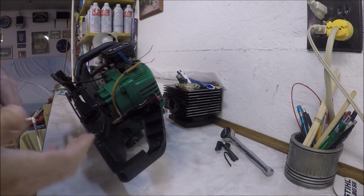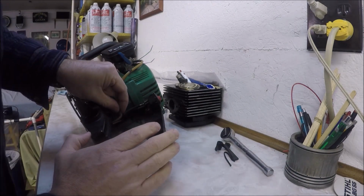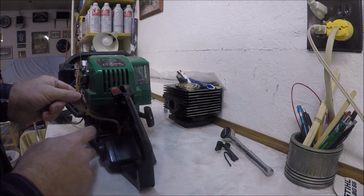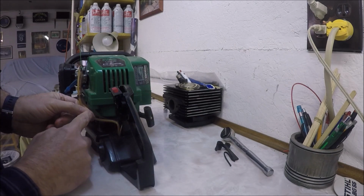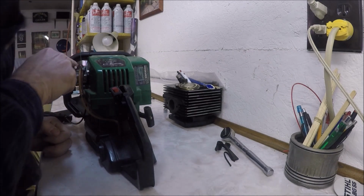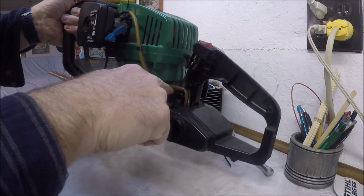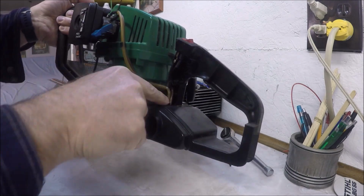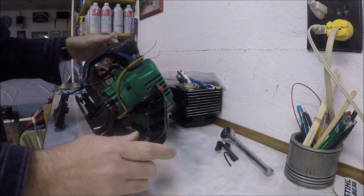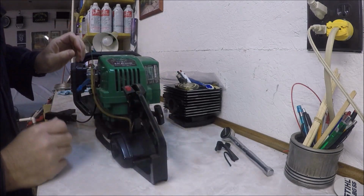So now what we've got to do is we've got to get the 2 fuel lines out. So the fatter tube comes out of the front hole and goes up to the top. The skinnier tube came out of, you can see it's, for whatever reason, it loops under and around and then down in. Try and duplicate that routing when we put this thing back together.